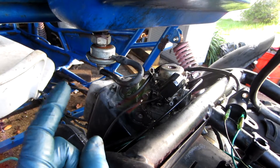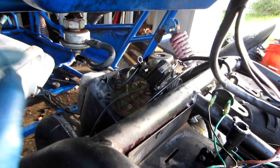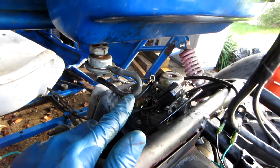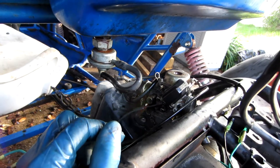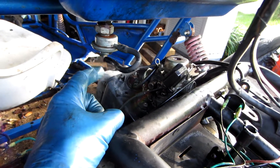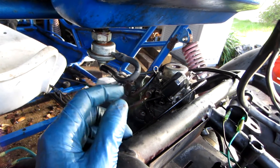Now the problem is that when they fail, usually the diaphragm will fail and dump raw fuel into the intake manifold, which fills your engine up with fuel and then fills the crankcase up with fuel — and that is no good. And clearly this one has failed because I have looped a fuel line around just to plug off both ports, because it's now dumping fuel out of both ports and will provide full fuel flow out of the main fuel line or the vacuum line with absolutely no vacuum present at all.